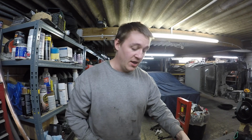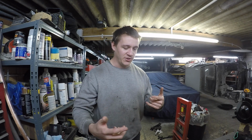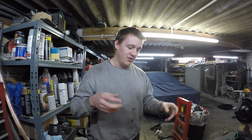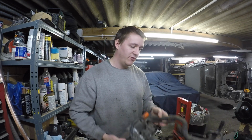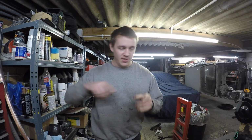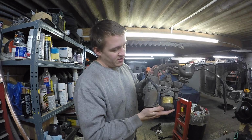And basically it pumps the ATTESSA, obviously. No, what it does, assuming there's some non-Skyline people watching this, the four-wheel drive on Skylines is controlled by oil pressure. It's got almost an automatic transmission-like transfer case. And then you use oil pressure to control how much torque is going to the front. Most of the time it's none, until you start to get a little bit leery, and then it's an amount. And this guy bolts on top of the rear diff, gets fluid from a reservoir in the boot, and then shoots it forwards to the transfer case. But it's kind of mank, right?